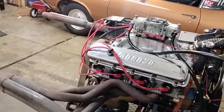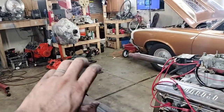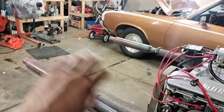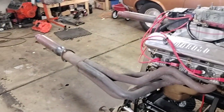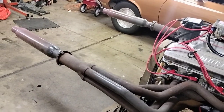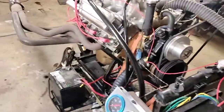I will completely disclose that this carburetor is fat for this engine, so you might see it pop, because all of that unspent fuel is getting reignited as soon as the fuel is being introduced into oxygen. So I'm going to call it the popcorn tune on this engine. But overall, this engine runs good. No major problems or noises or anything. So let's see if she'll be good to us, because we had that alternator problem.